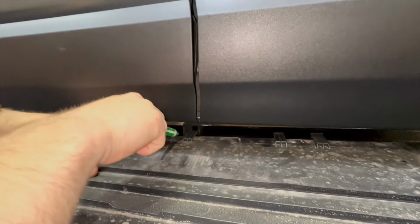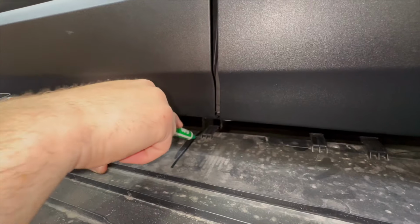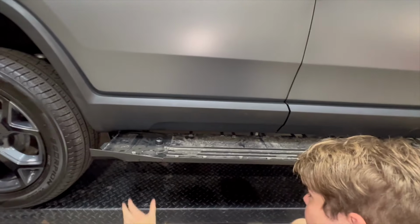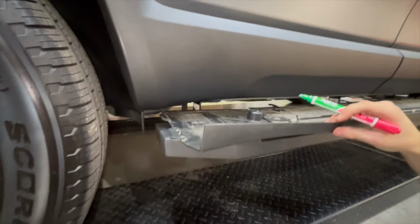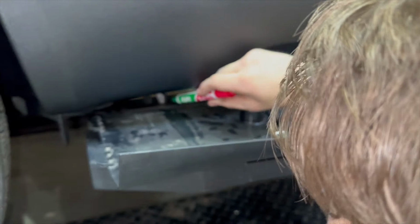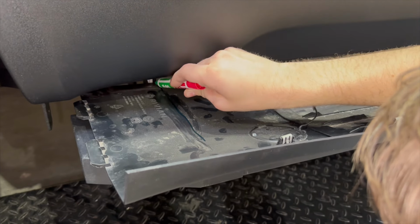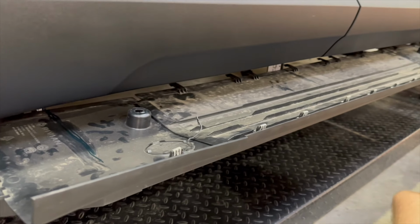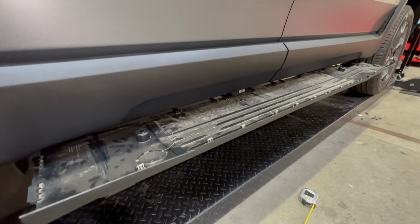And again, you don't want to make these slots too thin. You don't want to push on the rocker panel cover and have it a little ajar. So we suggest at least a 1/2 inch gap. We're going to show you how to trim out. So again, there is the bracket. All right, so that's it. Now we're going to go over the table and show you how long we're going to cut these out with our tin snips or some sharp scissors.